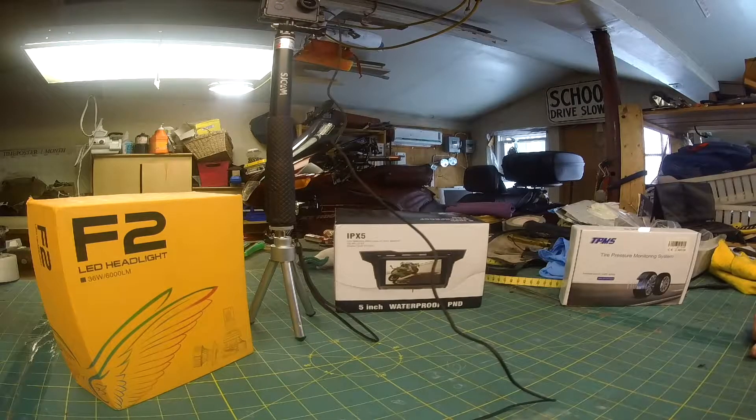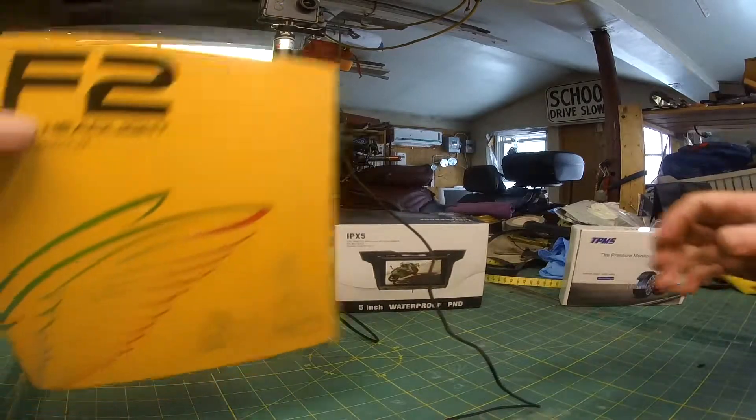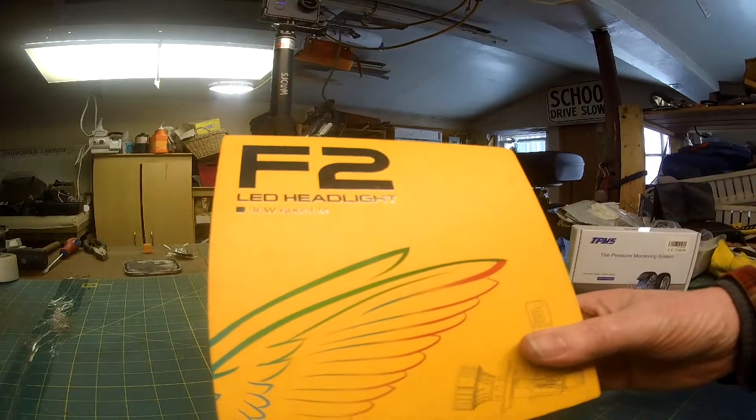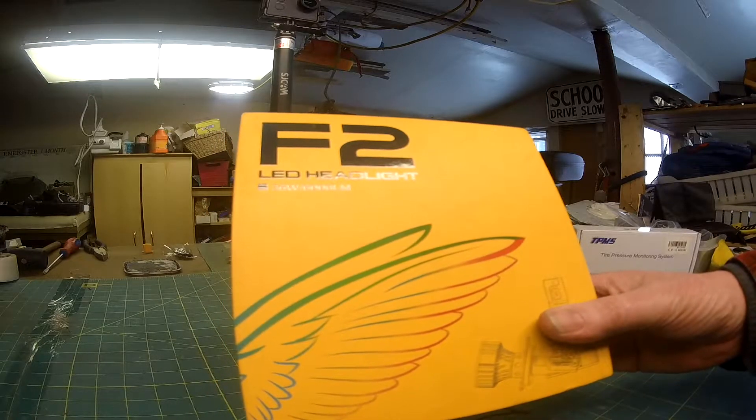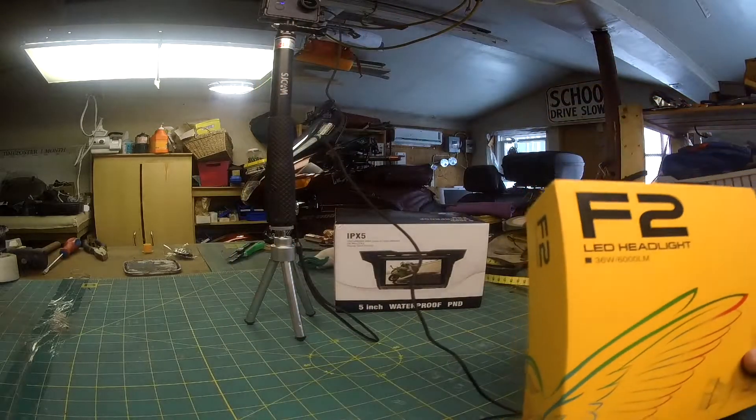When I had the bike apart I also got LED headlights. I'm fortunate because I acquired a European headlight, and that headlight allows me to use regular H4 bulbs without a shim, because the proprietary ones in North America were 45-watt, 45-watt. In Europe they can use the 55 and 60-watt bulbs.